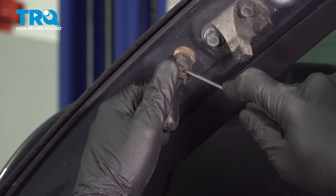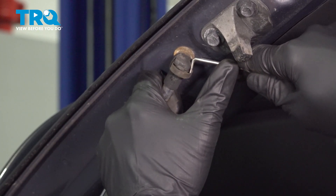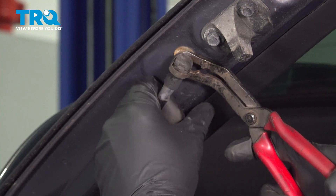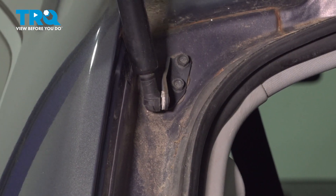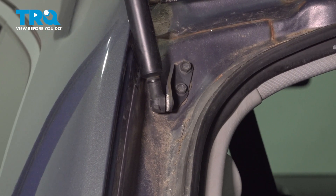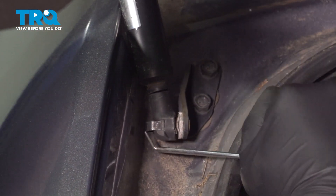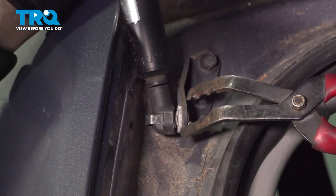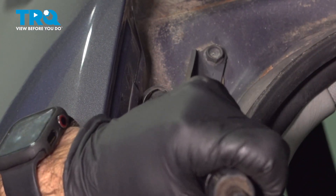The other thing you're going to want to do is take this band out evenly. Right now one of the sides is stuck in. Just use a little pry tool here to see if we can pop that end off. There we go. Now that we have our top removed, we're going to swing it straight up and work on removing our bottom clip. We're going to use our pick tool again to get that clip out. There's your clip removed enough so that now we should be able to get in there with a pry tool or just pull that straight off — just like that.